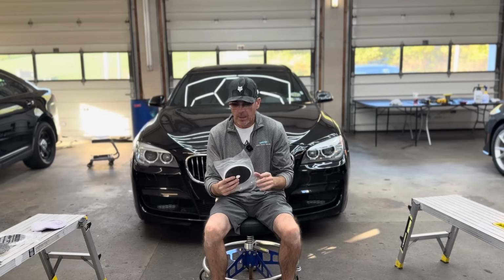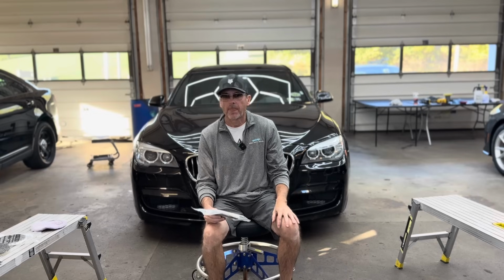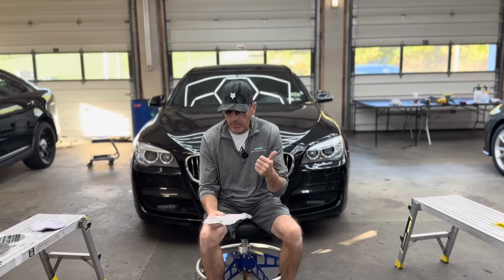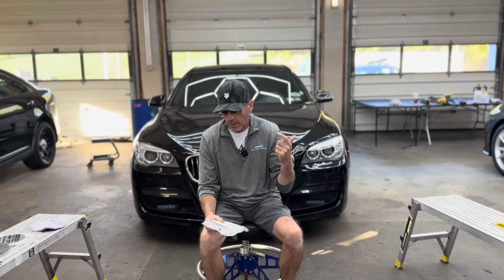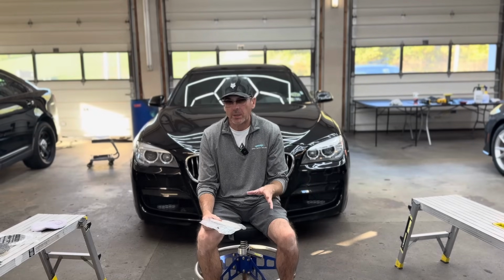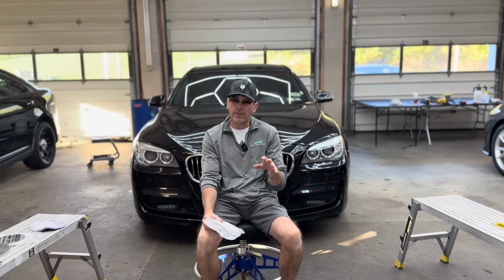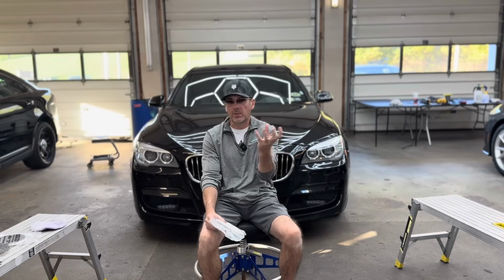so it's kind of a hybrid type of pad, and the fibers are about a 1/2 inch long. Why is that important? Well, that means you can use this pad on the rotary polisher, force-driven polisher, force rotation, your orbital polishers, dual action polisher. If you're going to use it with a dual action polisher, I would then use it on something with the longest throw possible, so those fibers get a chance to do something.